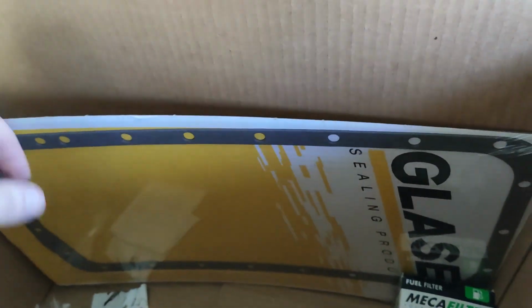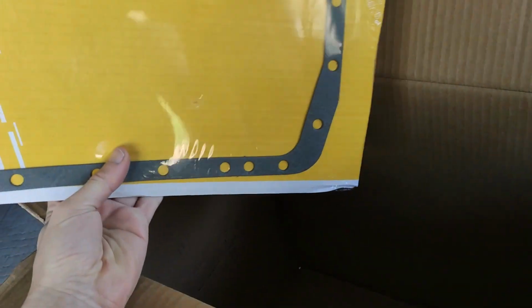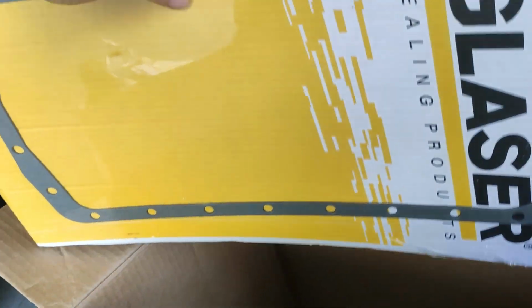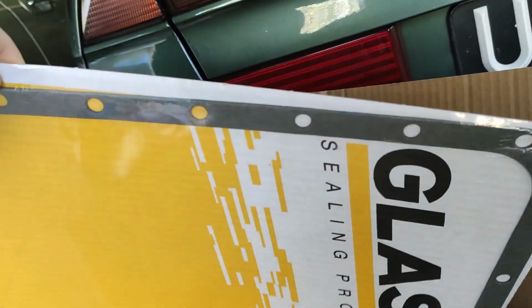This should be here, because it is from the rover, from the light in the boot. Our old tie rod, I took it to check if it really was the right size, and it is. A sump gasket, because we are gonna need to undo it. And looking at the difference between the holes, this might be the right one, because cars with AC have a different sump, because there's some sort of support from the AC compressor that goes there. This is basically what I paid for all of this, but we haven't finished.